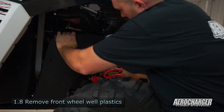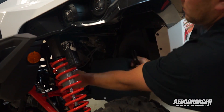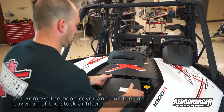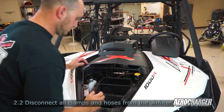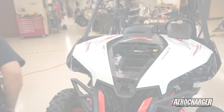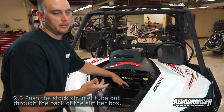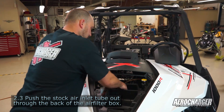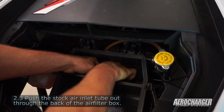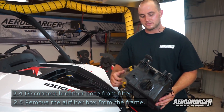A couple of push pins — just like that — and the other side. Next we're going to remove the stock air box. The first step is just popping the cover off. The next step is to remove the hoses; I've already loosened the hose clamp off the left side — there are two clamps, one to the box and one going back. The second tube back here can be a bit of a booger; you're gonna have to get a screwdriver or something because they glued it from the factory to the air box. You'll have to physically shove it back through the outside of the plastic. There's also another small hose with a hose clamp that you just pinch with some pliers and slide off.